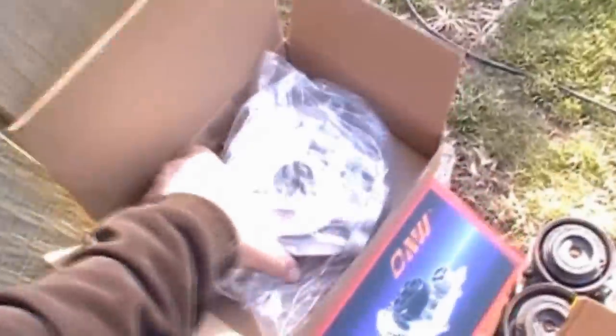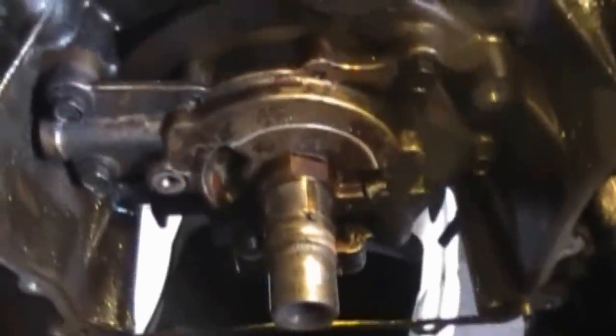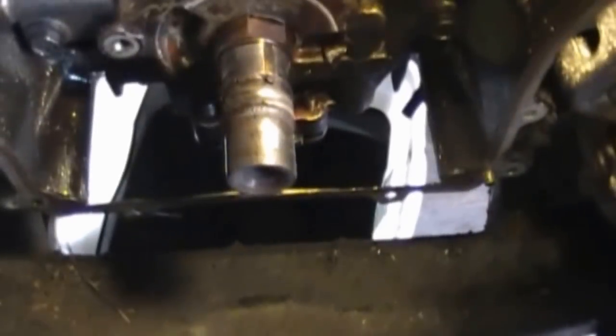When you get your new oil pump, make sure you take oil and prime it. Put it down in the hole there and soak this thing real good with oil before you put it on the engine - in case I forget to tell you that. I'm going to drop the oil pump now, take the sump off, clean it real good, put all this back together, put the oil pan back on, and I'll check back in a bit.